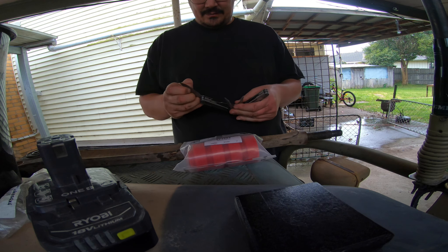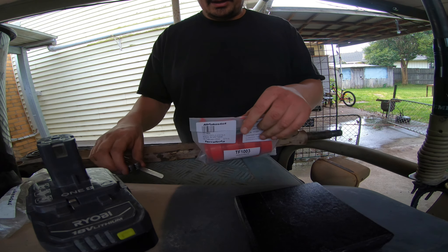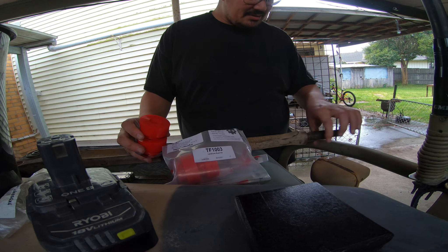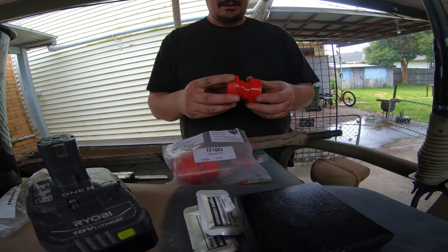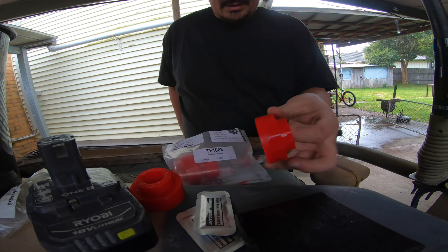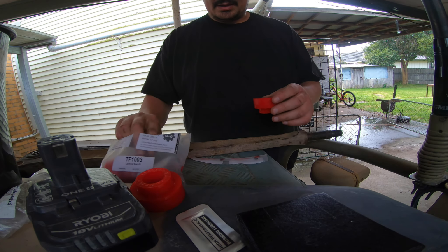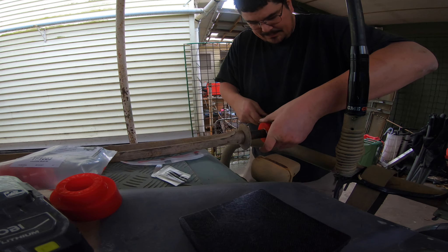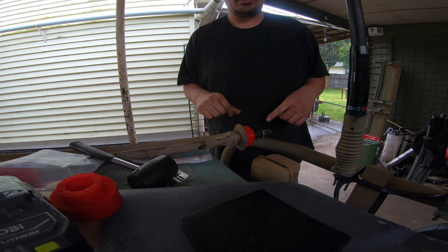This is a KLR auto part, which is the TF1003. Working on sponsorship with KLR - they're amenable to the idea but we're still in negotiations. So these are the bushes. We gave the end here a good scrub up and clean up. We're using the nylon bushes - on the previous one when I did this for the six-wheeler I used the rubber ones. These are supposedly much better and they do feel a bit like Nolathane. We're going to treat them with some grease, which they include - there's a portion of grease for either side. This one's got to go on with the washer. Now let's give it a whack. There's that one in. Now we crawl under and shove it in the other way.